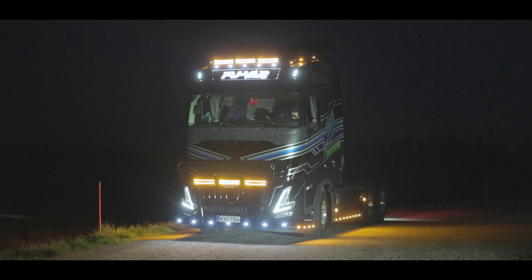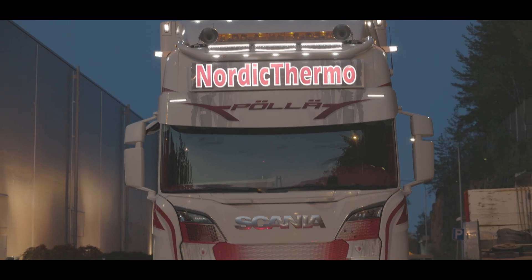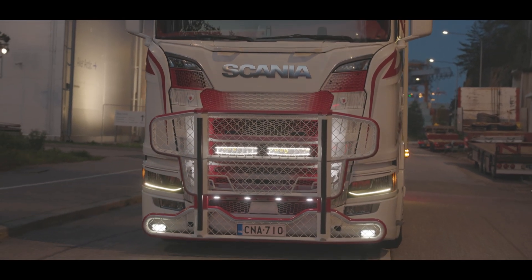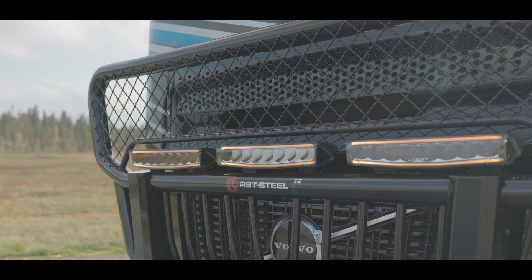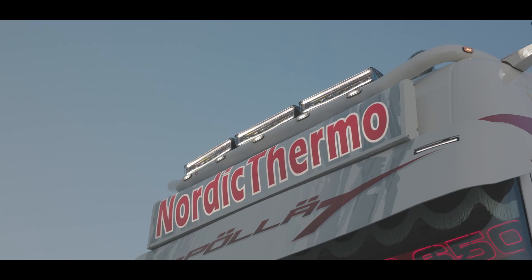In terms of the position light, because this is really one of the big reasons for customers to buy a light for their commercial truck, Air features a unique double position light — a row above and a row below the main reflectors. It's a light guide with a diffuser on it and it's able to be in either amber or white colour.